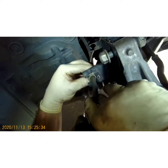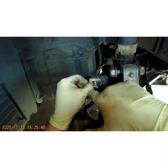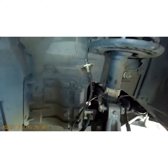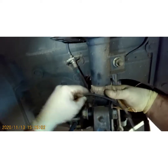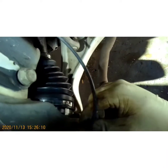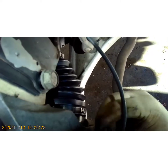Go ahead and put your brake line back in — it only lines up one way. There's a little notch, little arrow down there that goes in right there. You'll feel it seat. Take your clip and tap it back in until it seats — a socket works fine for that. Go ahead and route the ABS wire back to where it goes. Now that everything is secured it's not going to pull out on the wire. It doesn't take much to damage these wires — you can pull on this wire and it might not look broken on the outside insulation, but those little tiny wires on the inside will break with just a half-inch of flex. I've done it — that's why I stress it every time.